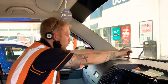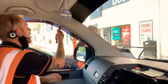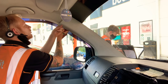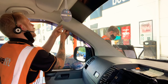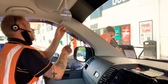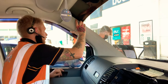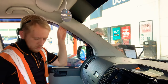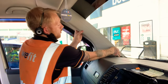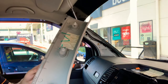Then it'll be the surround on the A-pillar. Put it on behind it and there is a little clip and it will pop out. If you give it a lift up, there are actually three clips on the back of this one. Lift up and that's removed — those are the three plastic clips as you can see.